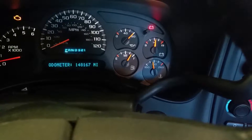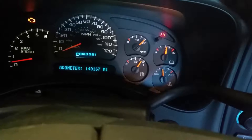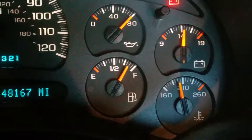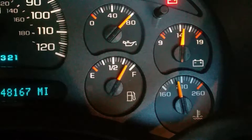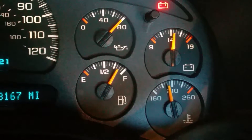He states that it's got a check engine light but he's not worried about it. Over there in the corner the battery light's on, and if you watch the volt gauge it'll bounce back and forth. It also needs an oil pressure sending unit - when you see one of these trucks where the gauge is pegged on 80, the oil pressure sending unit's bad. But he's not concerned with that right now.